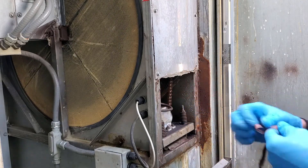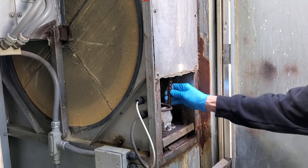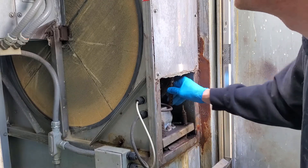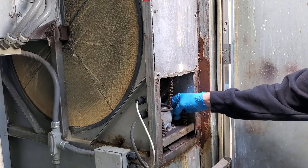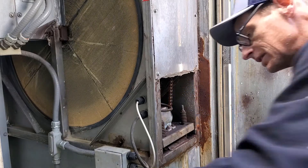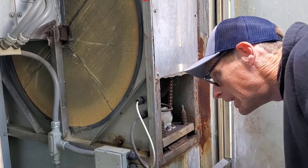That's not good. I'd say that's a seal probably. There's a lot of tension on there — that's not good. That means something else is going wrong here. The sprocket looks decent, there's definitely teeth on the sprocket. But seeing this in here is cause for concern — you can see how that's rippled up. That's been rolled over. I'd say that's the seal.